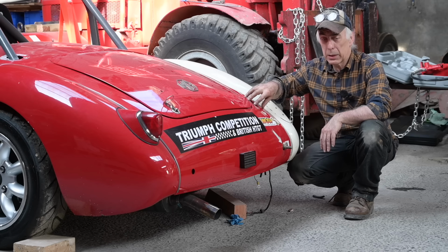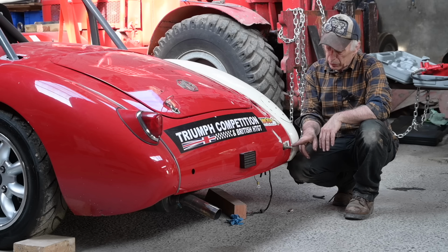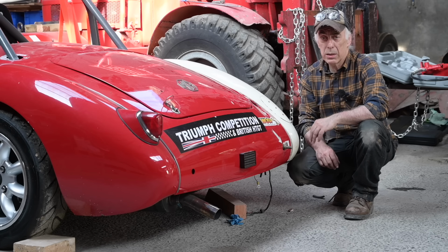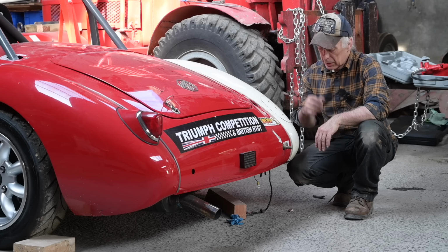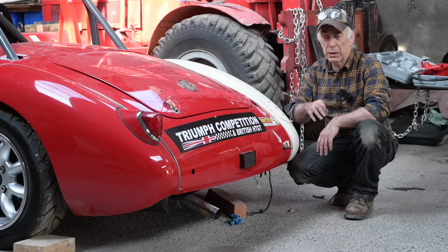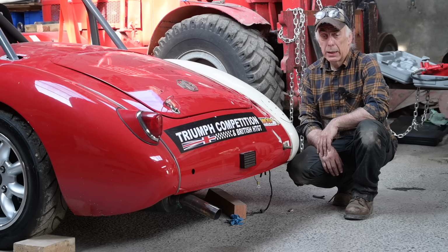I'm gonna fill that up because, as you remember, I might fit a fuel cell inside the boot. And we have to do some welding here and there where the metal was cracked, because I had several areas where we pushed hard and some of the welds are kind of cracked and not in full, but we need to restore that. There's some small adjustments to be done on the fenders where they fit to the body panel. The holes don't align 100% for the bolts, but that's just getting a little bit more polyester out, and then that's it. And then is the big paint job.